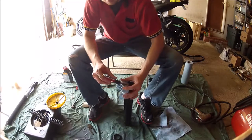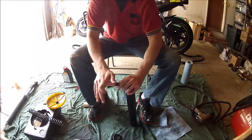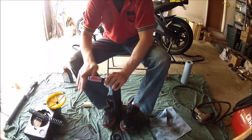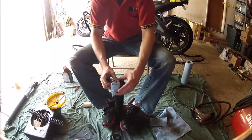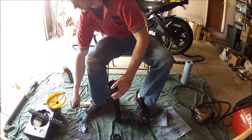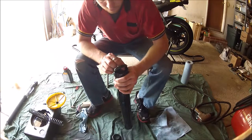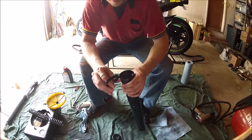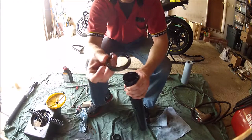What you'll need to remove next is the inner fork oil seal. This will take a little more effort and will be a lot easier with an actual seal puller tool, but I did not have one, so I just used a screwdriver. Either method works well. Once removed, there will be a small thin metal washer that you'll need to remove afterwards.